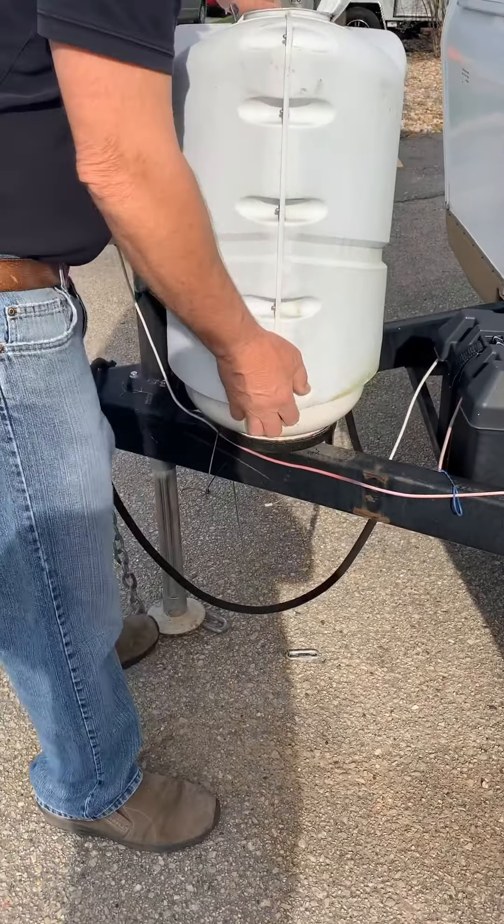You have your two tanks here. Open the cover and here are two valves. If we lift this up, you'll see there's an auto-changing regulator that automatically changes from one tank to the other. When it's on this one and operating, it's green. As this one runs out of gas, it will become red so you know it switched to the other tank.